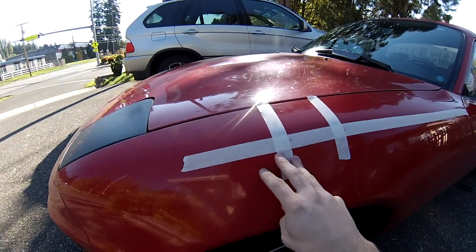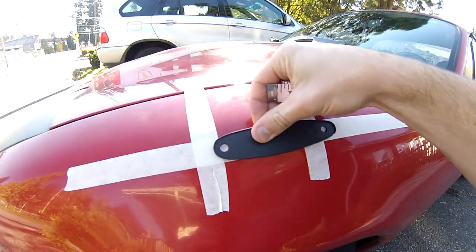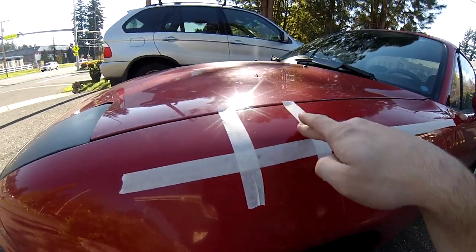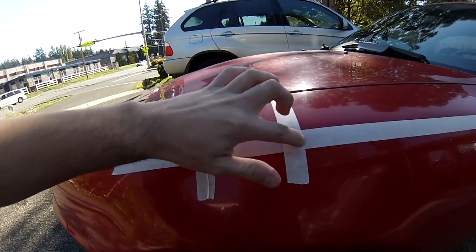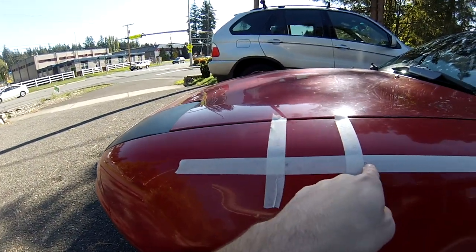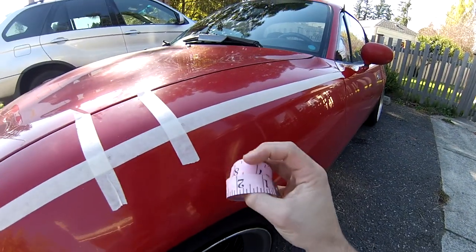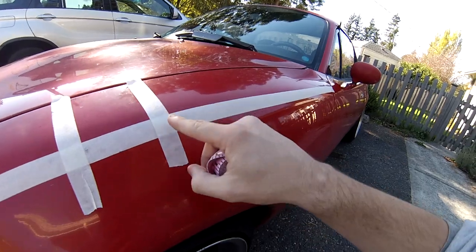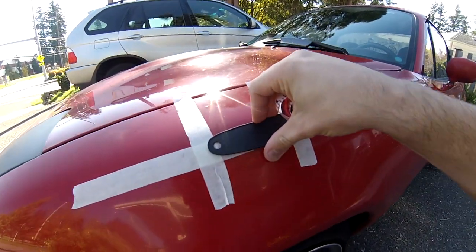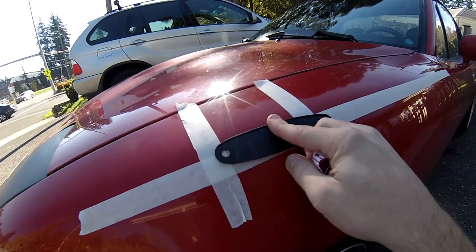Here's my makeshift masking area. These are both drawn through the holes on this piece right here. I'm using masking tape to go over it so it doesn't mess up my paint — just keeps it smooth. I put these here just to have a basic frame of reference. I'm going to measure from here to here and from here to here so I can do this exactly the same on the other side, as well as the distance between the two holes and the distance from one to the end of the fender. I'm using a flexible pink measuring tape so it bends with the curve of the fender. I tried to stay right on the fender line because the mounting plate is about the same width as the actual bend, so it should just sit right on there.